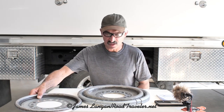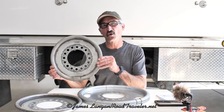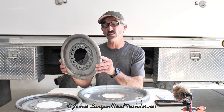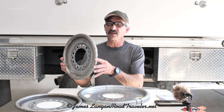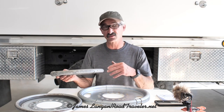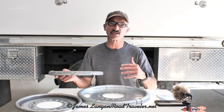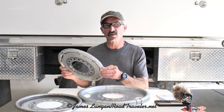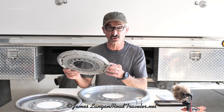To try to find a solution for that, I have tried this — a 400-448 balancer. This is designed for 17-inch wheels and larger, and it really is a dual rear wheel balancer. This balancer has about double the balancing potential of a 300-318. Instead of six ounces, it has about 12 ounces, which is quite a bit.